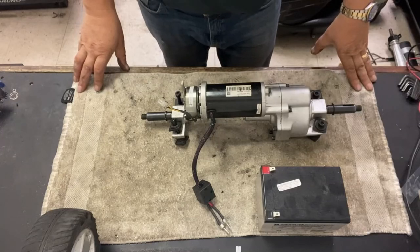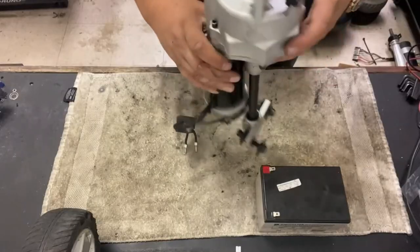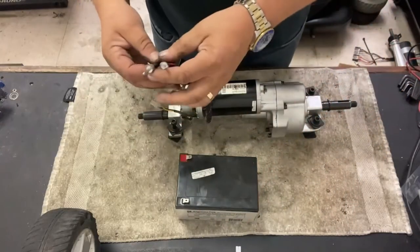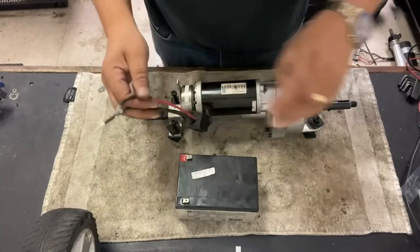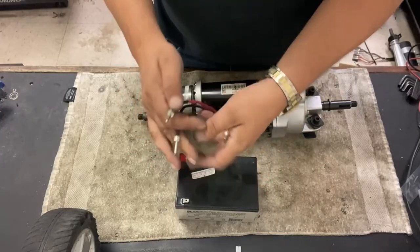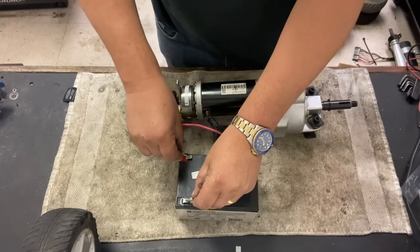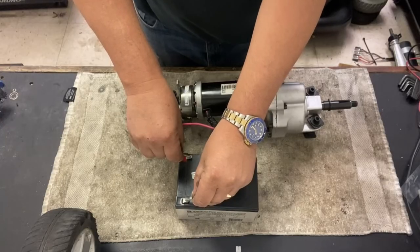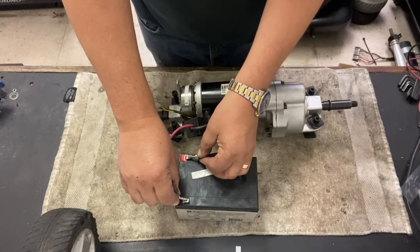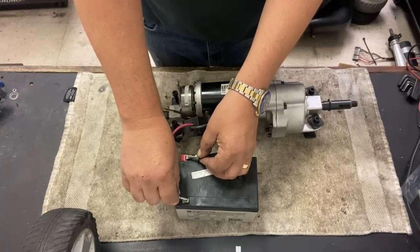Okay, that's all back together now. Brakes on, motors together, it's all cleaned up. Looks a lot better. Now we'll quickly test it, just to make sure it spins without making any noise. It's pretty free. Let's get it right way around. Yep, nice and quiet. Spins evenly. Try reverse. Yep, no problems there. Bearings are running nicely, no noises.